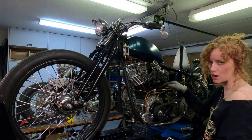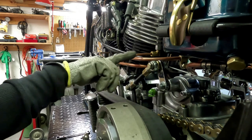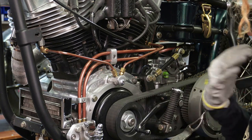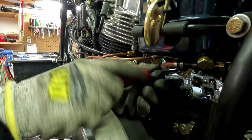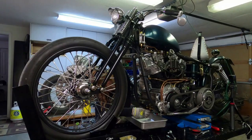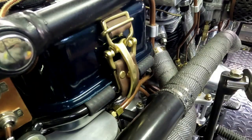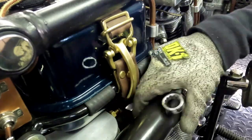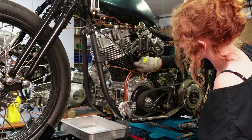I've got my oil drained out. To start, I've got to take off all the mounts that are holding my oil lines - all these aluminum blocks that I need to take off - and then a couple other mounts mounting the oil lines to the frame. I'll have to remove those before I can actually start removing oil lines. Some oil lines are just way harder to get to, like this one here - I've got like half an inch of space to work with.